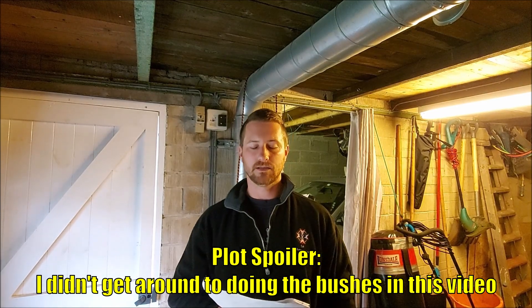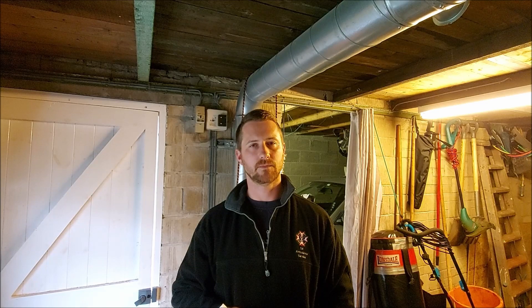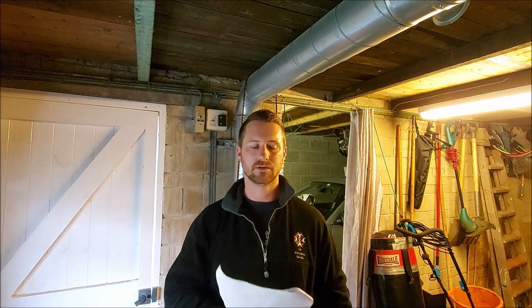Really annoyingly, when I went for my MOT last week, as I pulled off my driveway I heard a rubbing noise. I went to look and found the collar at the top of the coilover - where the top of the drop link connects - had spun around and taken a big groove out of the inside of the tire, and taken some of the metal off the wheel as well.